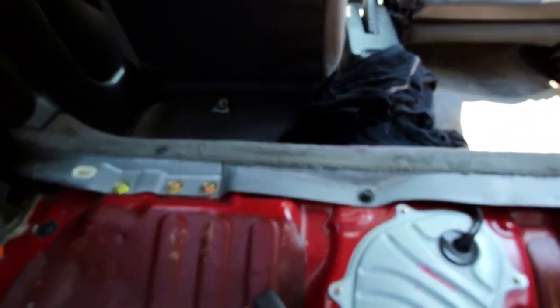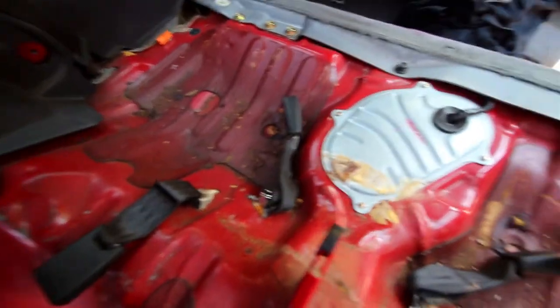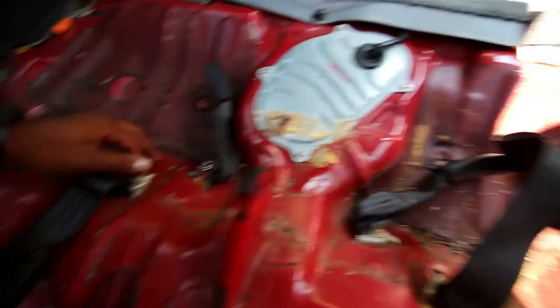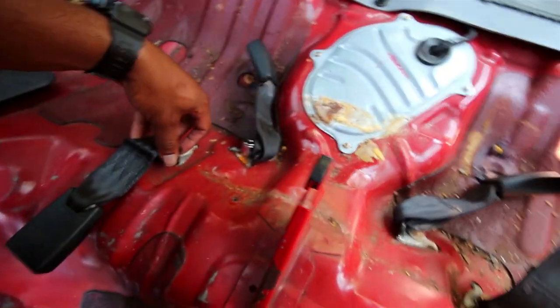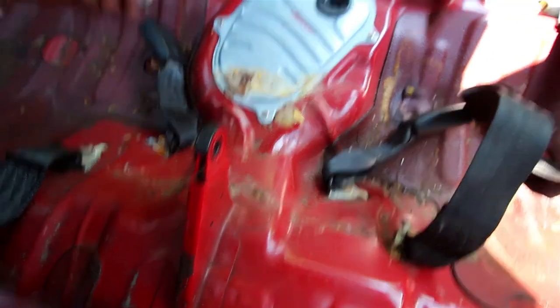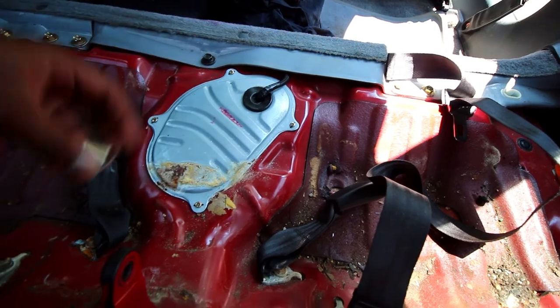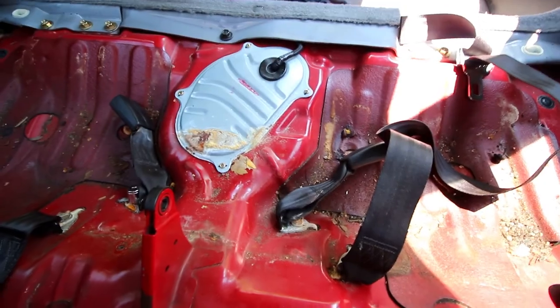To remove the four lower seat belts — yes, four: the uppers are the actual seat belts that go into the buckles, but there are four buckles attached to the rear chassis, one, two, three, four. To get these loose they are a 14 millimeter socket. Unscrew them and that's pretty much it to get the seat belt buckles out.